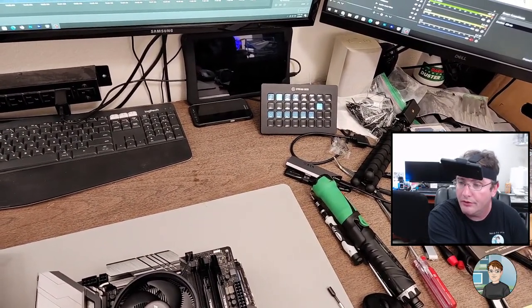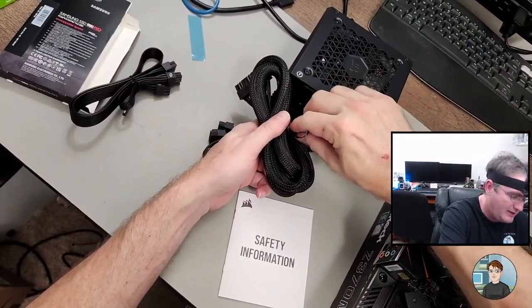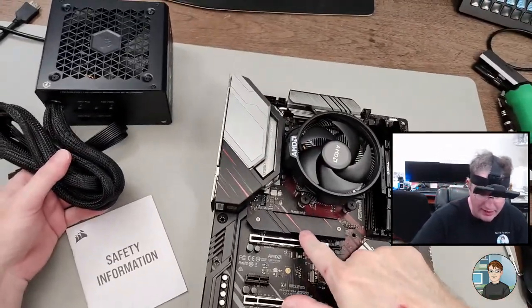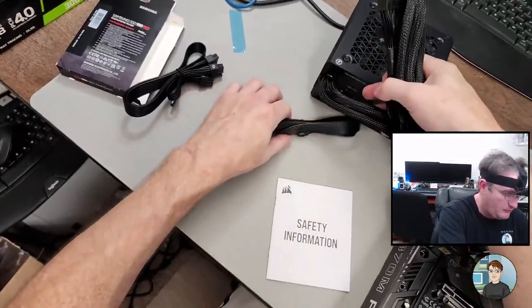Michael Perth redacted a message. It said something about, does it reduce the performance by having it right next to where you would have your graphics card, and I believe the answer to that is no. The slot here and the graphics card are given different lanes to the CPU.